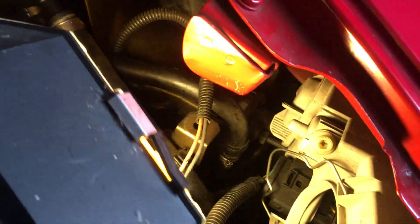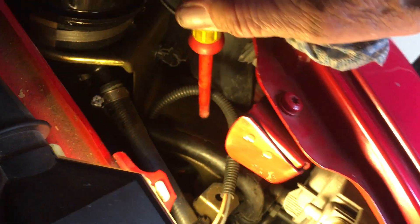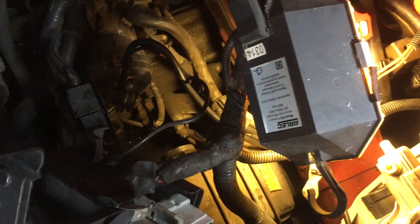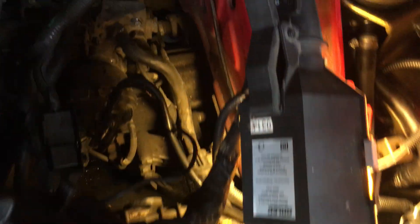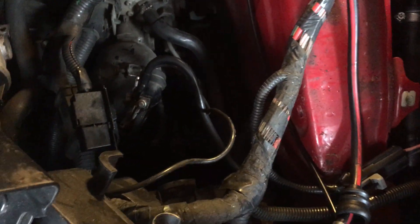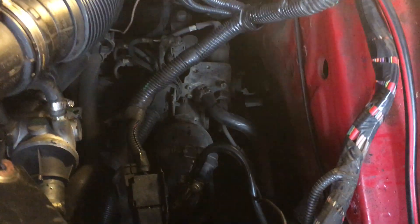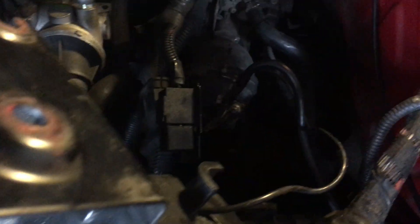What you can do to confirm it is get a hammer or steel bar — I'll show you with a screwdriver. That is the top of the bracket that the pump is mounted onto. If you tap that hard a few times with the door open and the motor cuts in, that confirms the brushes. What happens is the brushes wear down and stop touching the electrical parts in the motor, so tapping it may just make the brush connect. You can get different results hot or cold due to expansion. If you tap it and the motor goes, you know straight away it's your brushes — you've got to take it out and fix it.